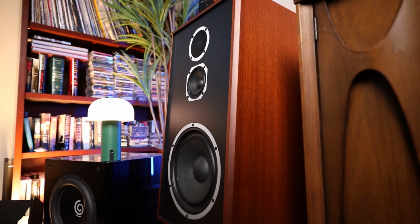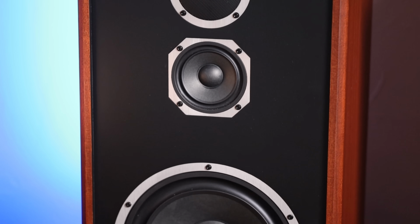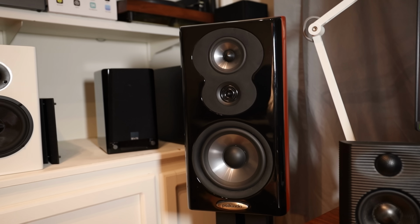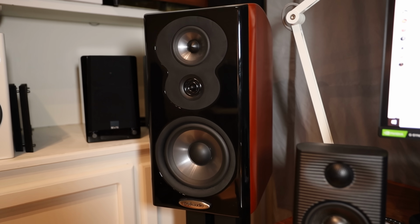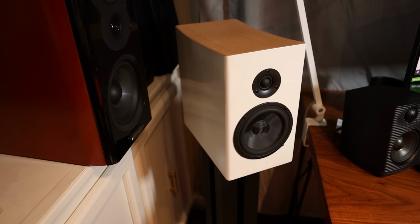Next, I paired the amps with the KLH Model 5s, which are known to dip a bit low in impedance, but it wasn't an issue here. Low-level listening, as well as relatively loud levels of volume, were passed along with powerful and controlled amounts of bass. My final pairings involved moving a single amp to a smaller room in my office and connecting them to a classic that I just can't let go of, the Polk LSiM 703s. It had no issues driving these to uncomfortable levels in a smaller space like this, all while maintaining a tight control on the bass.